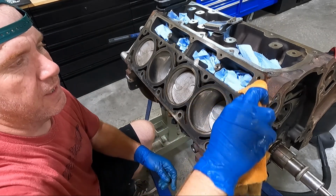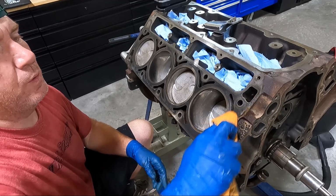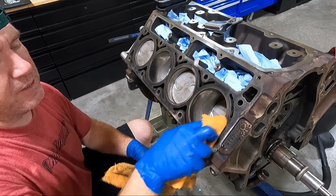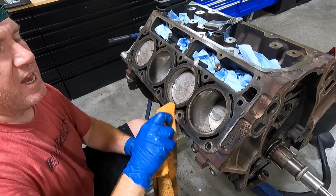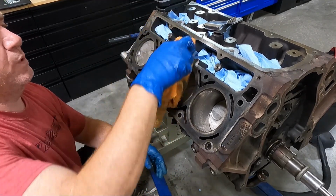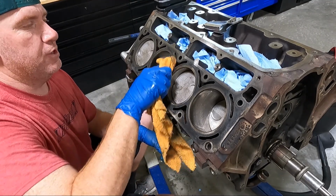And basically, it's kind of like rinse and repeat. But the next step is we need to clean out these bolt holes. I'm really to the point where I can start that because I've got a majority of the big stuff off the gasket, so I'm not going to be pushing a bunch more in there. I may go over this one more time off camera with a brand new razor blade. That's the other thing, guys. Switch razor blades often. Make sure you're using something fresh.